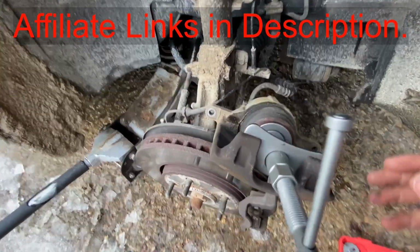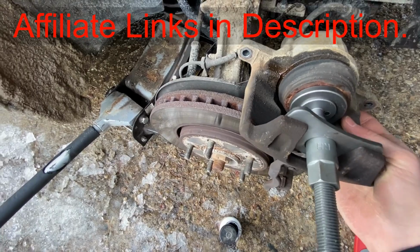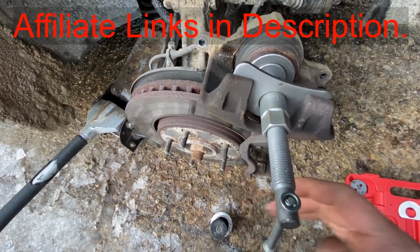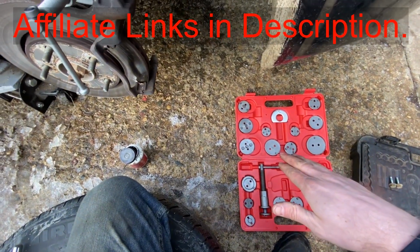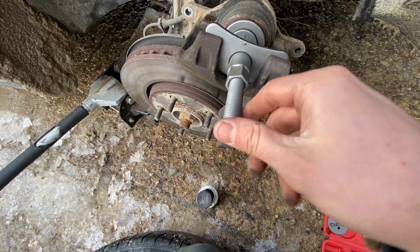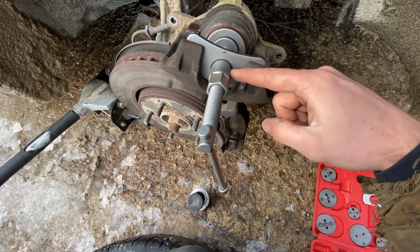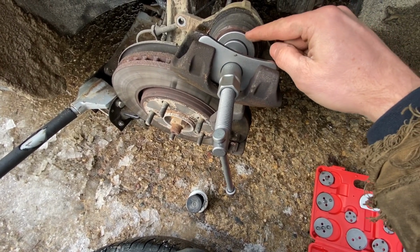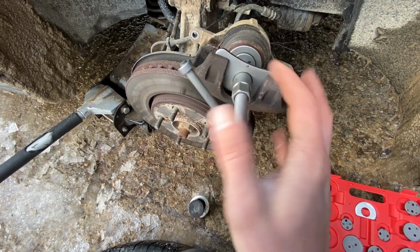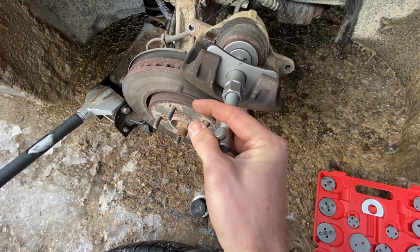Last thing we're gonna do before we put it back together is push the caliper piston back into the caliper. So I've got this brake tool also linked in the description below. Basically, you just got this plate that slides on here, and then an adapter right here, which is just a circle disc, and you just start turning, and you just push that caliper piston back into the caliper.